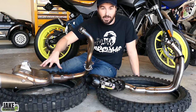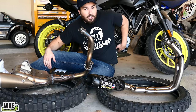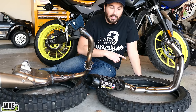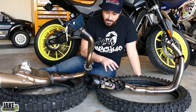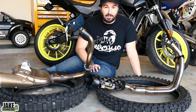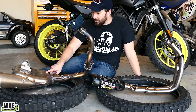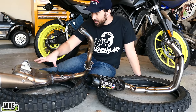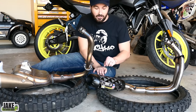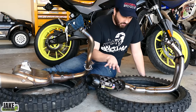The stock system gets really hot when it runs, especially with a cat in it, and all that heat rises right up into your engine. I've noticed this thing gets really hot really fast. When we retuned the ECU I set the fan temps a little lower — hopefully this will help. I can't believe how fast this little engine heats up, even on a cold day in traffic. This stock exhaust definitely contributes to that. It gets untouchably hot in just a few minutes of running. The Two Bros can, on the other hand, is carbon fiber — not only lightweight, but it has much better heat resistance.